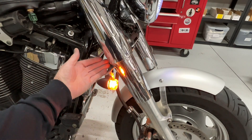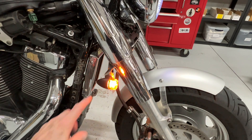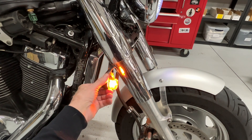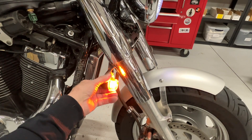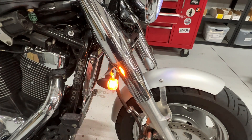And there you have it. I've routed all my wires up behind and tucked them in, wire tied them in the back to the hoses — so it's nice and clean in the back. When you tighten these up, be careful: these are hollow stems back here, so as you tighten them don't get too carried away — you could break that hollow stem off. Just snug them up to where they won't rotate. I like to have the light level to the ground — maybe a tad up, but level. Tuck your wires in and make sure everything works. This is flashing fast right now because I don't have the rear lights hooked up yet; once I hook up the rear, the front will flash at a normal rate. What a cool way to go — you have light!